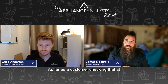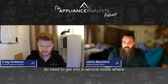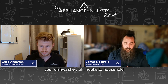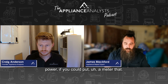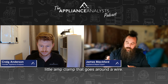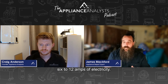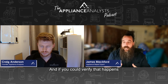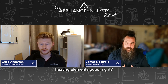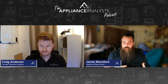As far as a customer checking that at home, it is pretty difficult because you do need to get into a service mode where you can activate the heating element. But if you are able to do that, where your dishwasher hooks to household power, if you could put a meter that monitors amp draw, which is usually a little amp clamp that goes around a wire, the heating element should be pulling anywhere from like 6 to 12 amps of electricity. And if you could verify that happens, 100% your heating element's good and the fuse in line with your heating element's good.